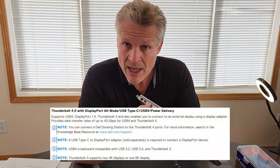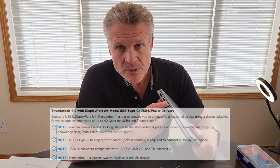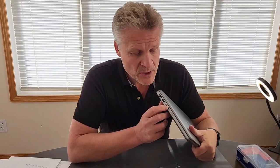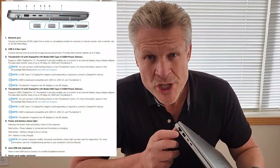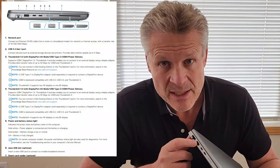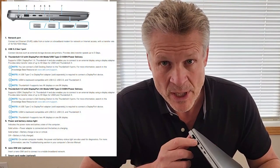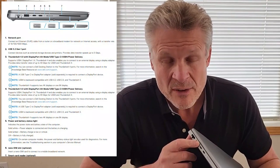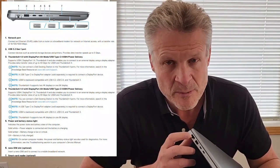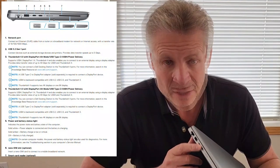So why do you care about that? It means you can put a lot of things on them. For one, they take power in. For another, if you connect video to these Thunderbolt slots, you can get up to four external screens — pretty cool. If you want to use the laptop screen, you can get up to three additional screens. This is a USB 3.2 Generation 1, which means it's 5 gigabit per second. Generation 2 would be 10 gigabit per second, but for printers, keyboards, mice, and most stuff it doesn't make any difference at all — it's way overpowered. The Thunderbolt ports are what you'll want for anything with a lot of data transfer.